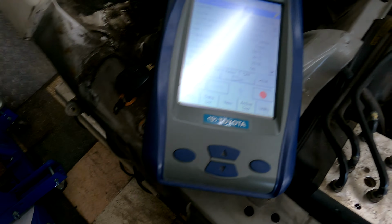Okay, so next thing we're going to do is start the engine up. Once we start it up, we'll see that the starter circuit works fine because we'll do it from the key. The tacho will work on the dash. We've already set that correctly. We'll go and check that ACIS valve we spoke about. We'll quickly do the oil control valve tests. Coolant temp, well, we've already seen it going because we've carried these tests out before we filmed. And we'll check that we've got no codes. All right, once I start it up, it's going to be noisy.